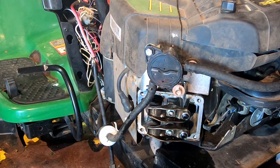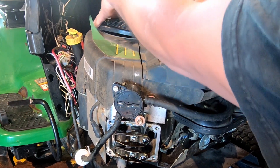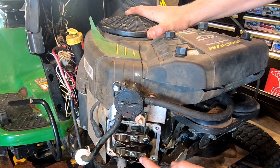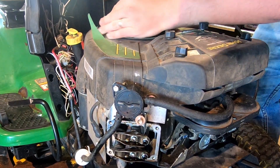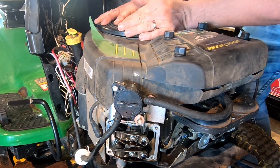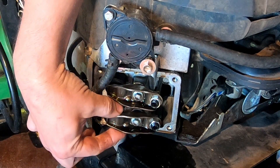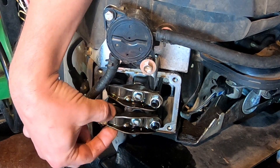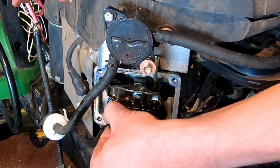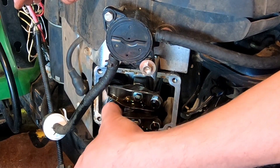The way that you check these is you rotate the motor to where one of the two is fully pushed out. You can see that the bottom one is moving back in and now the top one is moving out. So we're going to move it to where this one is all the way out, which means this one is just at rest so to speak. That looks like a lot of slop to me — I can definitely move that in and out a little bit.